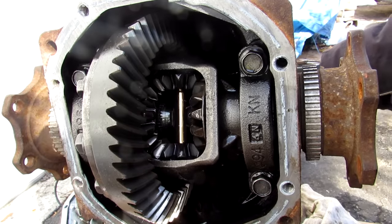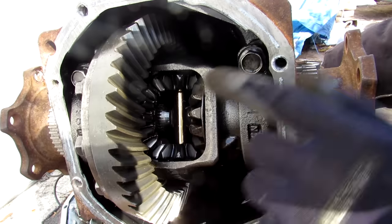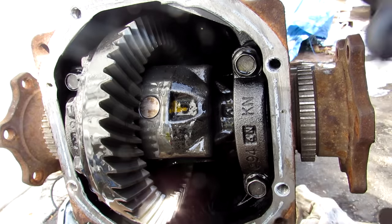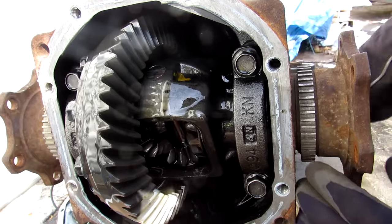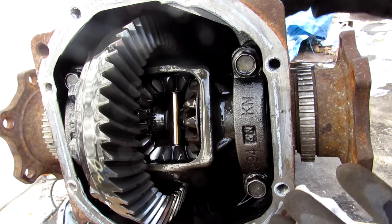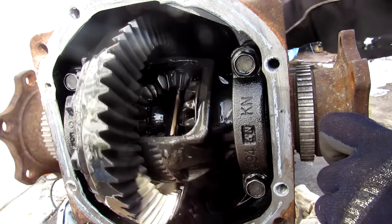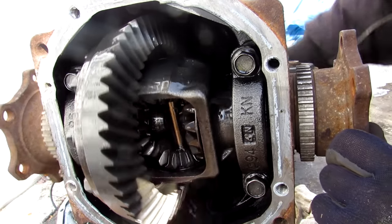Likewise, if I lock up the pinion as if the vehicle is in park, and I rotate the right side wheel, you'll see that the ring gear does not move. Only the differential gears on the inside move, and that allows the other wheel to turn in the opposite direction. Now this design is known as an open differential, and its main disadvantage is traction. For example, if I'm rotating the pinion gear and I hit a patch of ice on this side, the energy from the engine has a tendency to go through the path of least resistance. It's just going to turn and slip this wheel while this one remains stationary — so you're going to be stuck on that ice doing a one-wheel burnout while the wheel that has traction gets no torque.